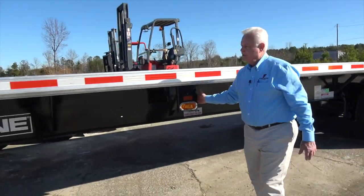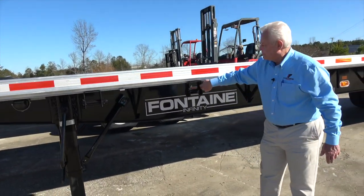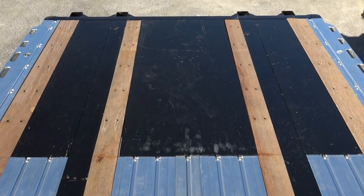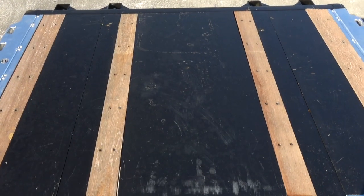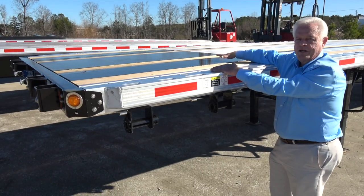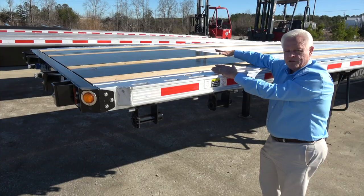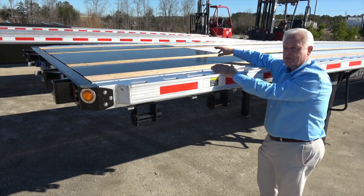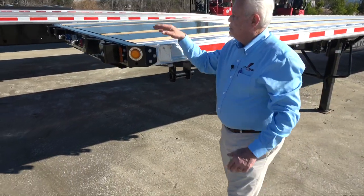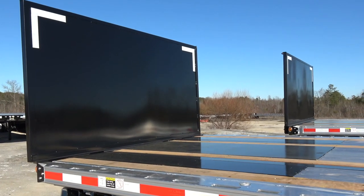We have a mid-turn signal, and you have 12 sliding winches — 6 per side. Up front, we've put our counterweights on top of the floor, flush with the floor. There's about 1,200 pounds of counterweight up here — a number we arrived at in conversation with different forklift manufacturers throughout the country, as that was the recommended amount. If you need a little bit more, you can add a bulkhead like we've done on these two trailers over here and add another 300 pounds.